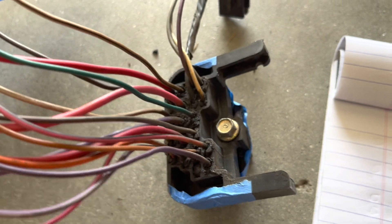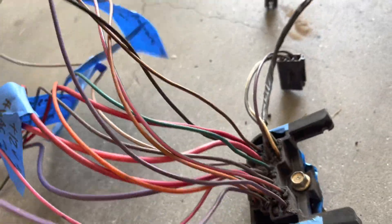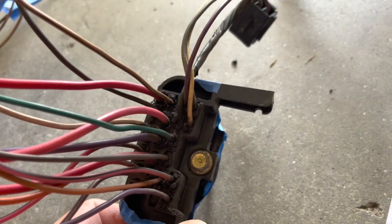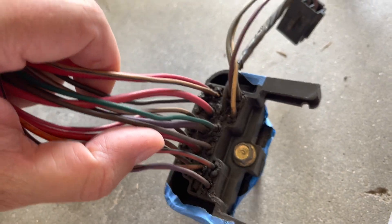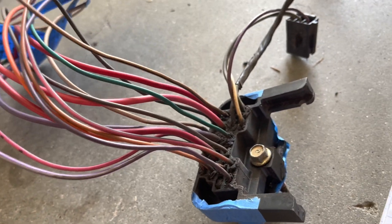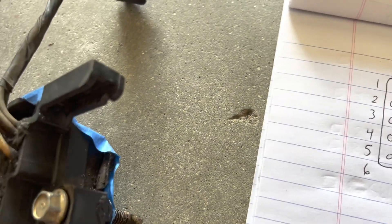A2 is a dark brown wire and I have it marked as air switch to TBI. This truck was throttle body injected, fuel injected, and that's mostly why I have every single wire here — it all went to that computer-controlled stuff. Whenever I say something is for TBI, that's what it means. B2 is a thicker pink wire — that's all your switch power for your ignition.